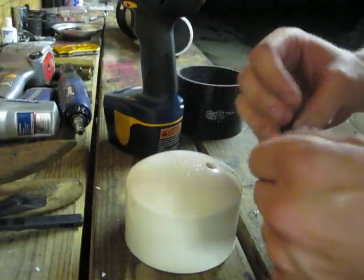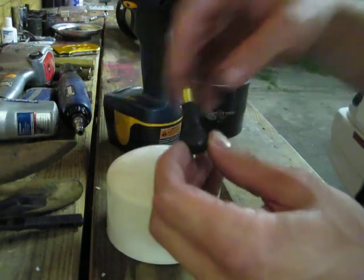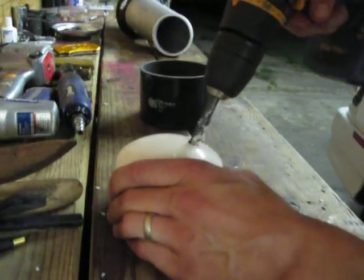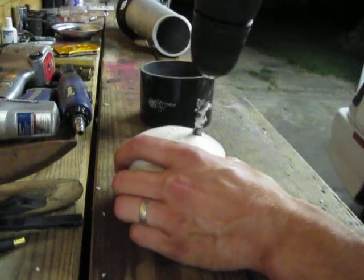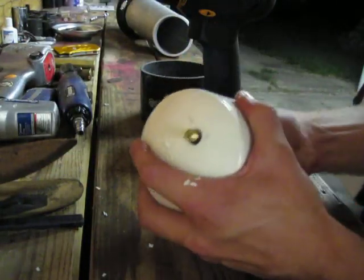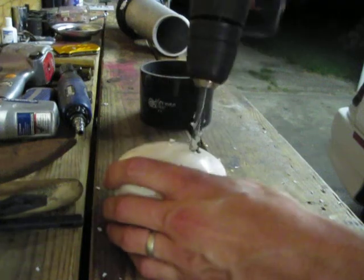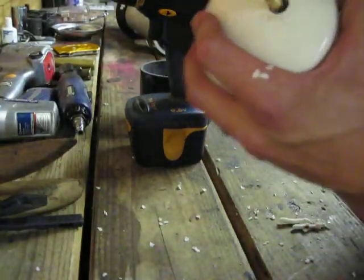You'll want to drill out that hole until you can fit this valve stem. You'll want to start fitting that rubber piece up through there. You can also use a bolt-on method that has a nut on the back side — I've seen a lot of people use those with great success. I had this one laying around so I'm just using it. I would recommend reading the back of the package and following the directions on what size drill bit to use — then it's just one simple drill through and the valve stem will press right through and sit perfectly.